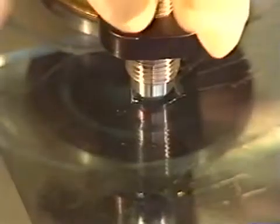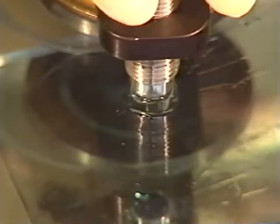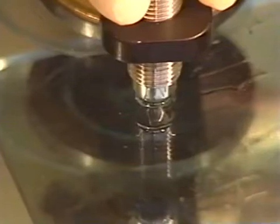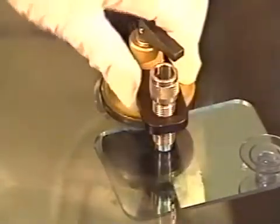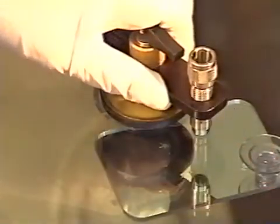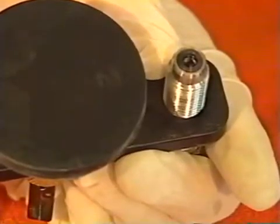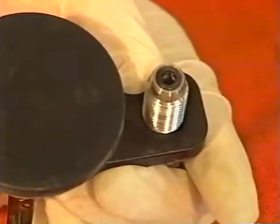If you see resin oozing out of the injector base, you have not made an adequate seal over the impact point. To readjust the position of the bridge, release pressure by holding the injector base with 2 fingers, unscrew the injector press and remove. Then slide the bridge over, wiping the impact point with a clean, dry, lint-free cloth. Repeat the setup process. If it is still leaking, remove the bridge and check the O-ring for lint or cracks and clean it off with a clean, dry, lint-free cloth, or replace the O-ring.